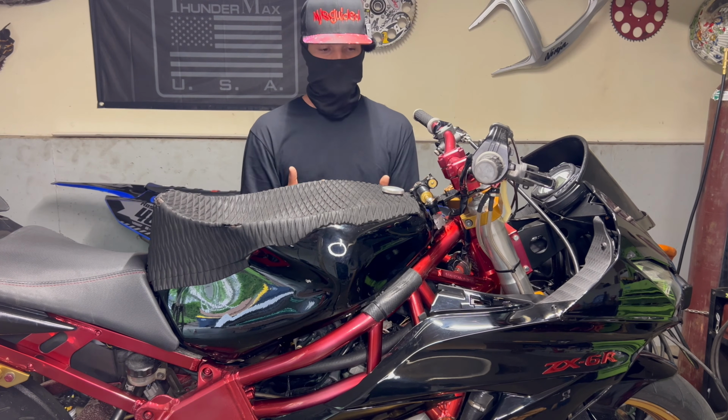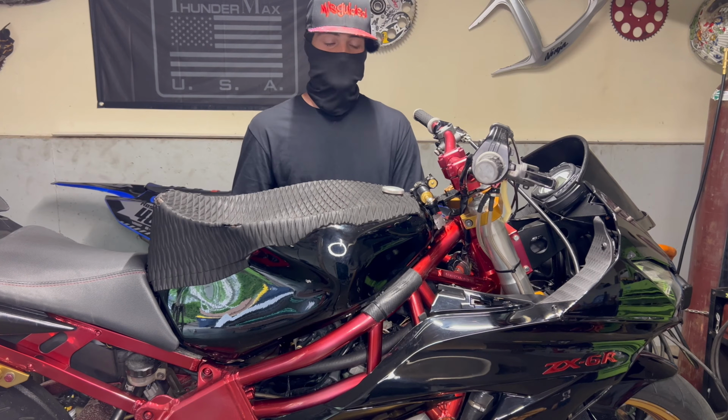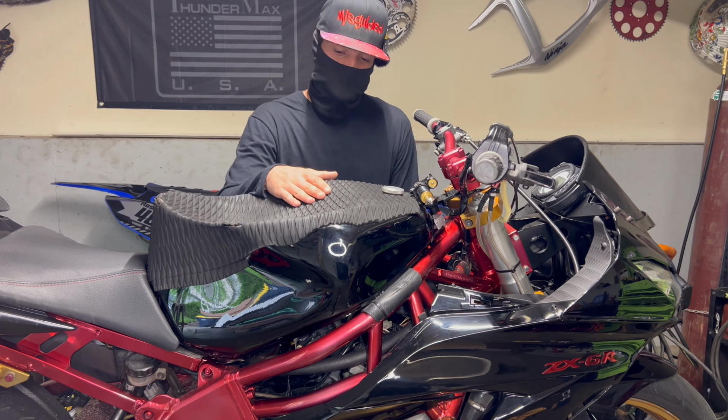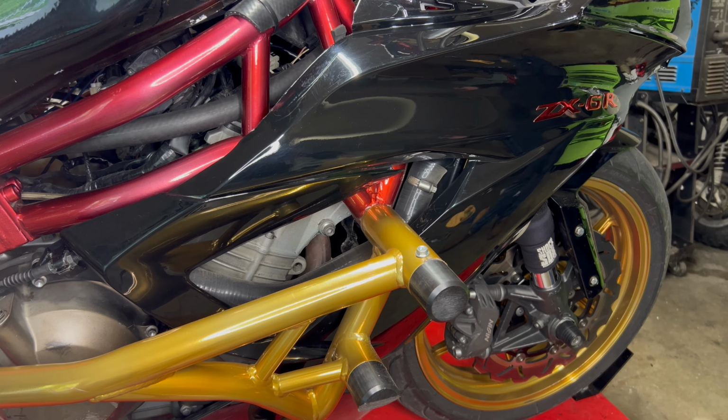What's up guys? What I'm gonna do today is show y'all how to do step-by-step throttle sync on a 2003, 2004 ZX6R. It's all the same concept with every bike that has a throttle body, but I'm about to show y'all step-by-step how to do it on this bike. Let's get to it, baby. I'm gonna go ahead and start this bike and warm it up between 180 degrees and 200 degrees Fahrenheit.